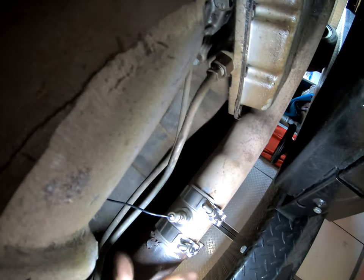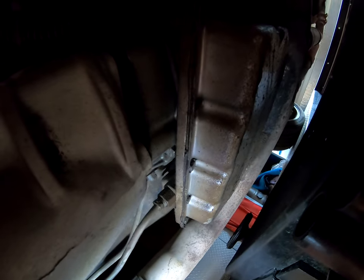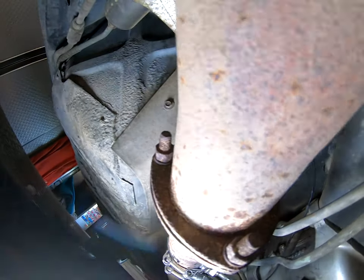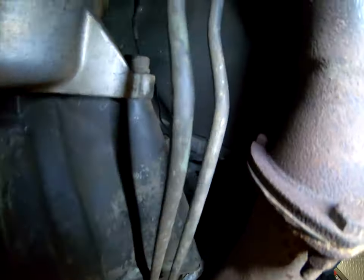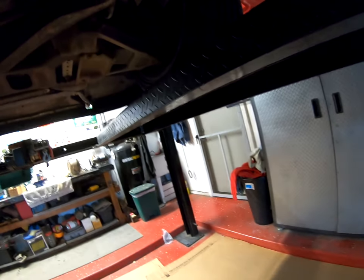"Crazy for you" — okay, that is done. I did extend this wire but I didn't show you that. I had to solder a piece in the middle because I couldn't route it here, I had to put it here — the wire was nowhere near long enough. I hope that doesn't cause the computer a problem; if it does, oh well. There's a joint there and I brought the wire around here so it didn't fall against the exhaust. Let me see if I can show you the route I took.